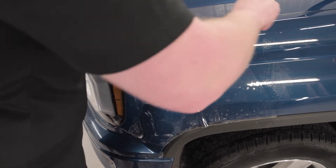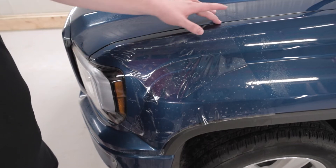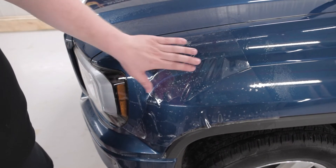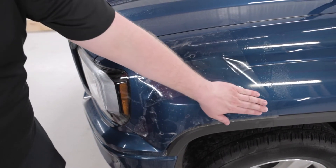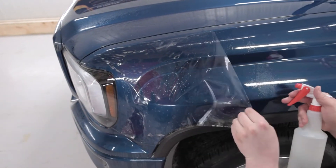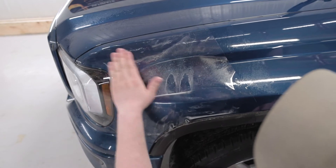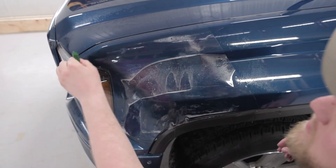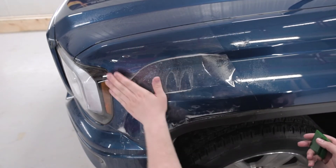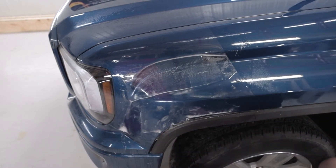When we're done with the installation, I'm going to take a heat gun and go along all these edges to make sure they're all the way down with no moisture left behind. But for now I'm going to get the tack solution in here and squeegee out all of this to make this film disappear. In a valley like this where you have a lot of air, what I like to do is take your tack solution and spray a good healthy amount in there.